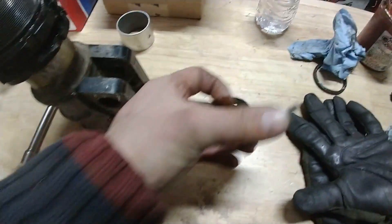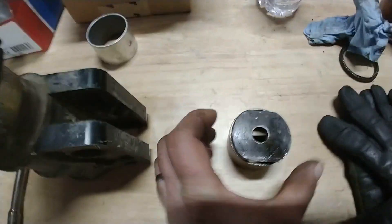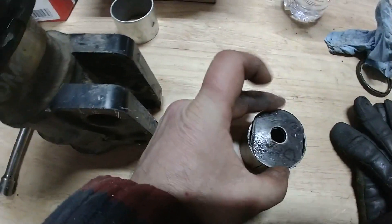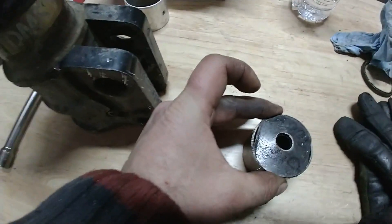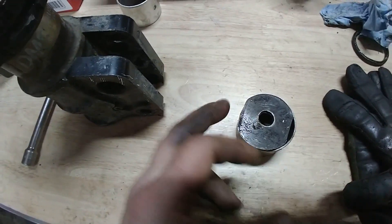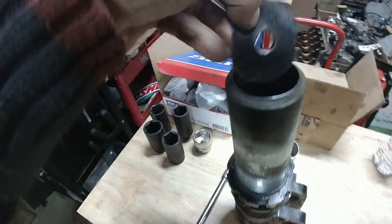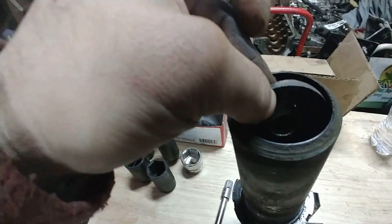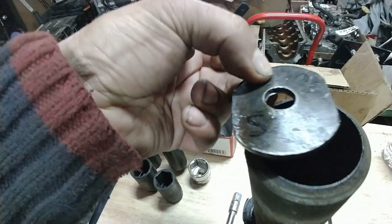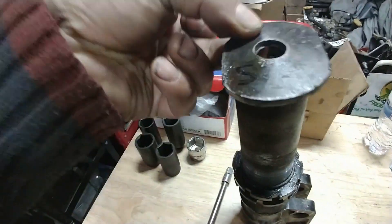So I made this small thing that looks like what you would find in a regular extractor. You just cut a piece of metal - it's relatively thick and basically the same size as the bushing on the outside. You cut the flanges on both sides so that you can insert it into the shock, slide it under the bushing, and then make it come flat so that it will push the bushing out from the back.